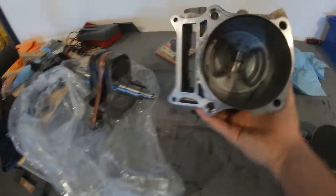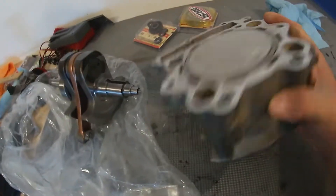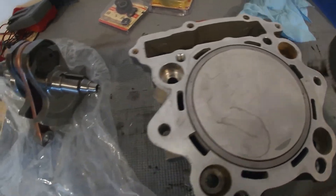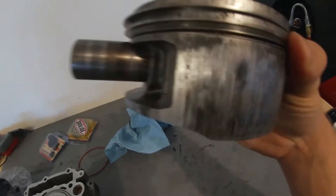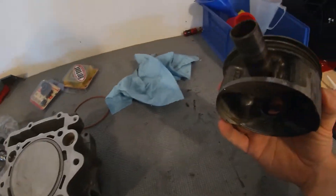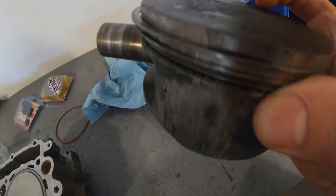Here's the old cylinder — I had it five over. He cleaned it up on the inside and found the piston to match. So there's the new piston, and compared to the old one, the old one's not bad, but you can see there's a lot of scoring on the side, and the cylinders on this were pretty bad. We were able to take care of that. That looks pretty rough.